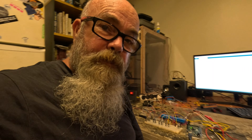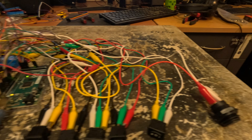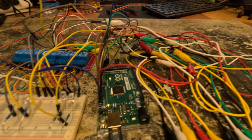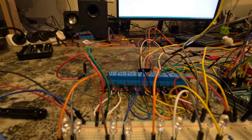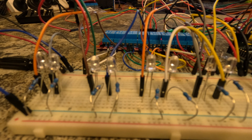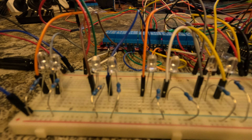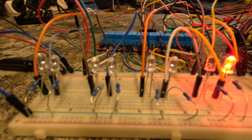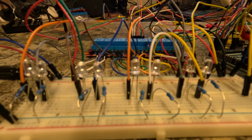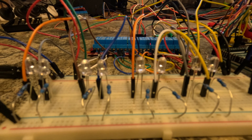All right, we have a working bench test prototype. This proves the logic works. Now let me show you what's happening here — if these LEDs light up, it means everything else is working. Window one up, turns itself off. Window down, turns itself off. These are currently on a timer. I'm going to use resistance recognition for the real thing, but these are just on a timer in milliseconds for now.